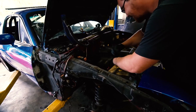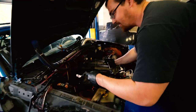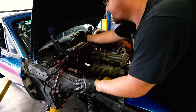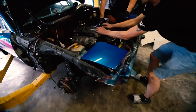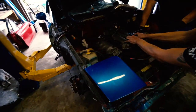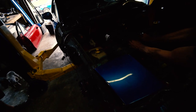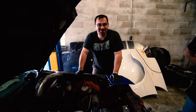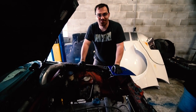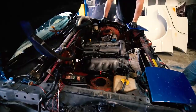I don't want to be right. I was just saying it's easier to pull the manifold off than to pull the turbo off the manifold, especially if you've got to take it off at some point anyway. All right, I think we're good to go up. Send it. It hits the turbo on the frame rail, and then the intake manifold is hitting the frame rail too.